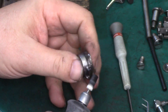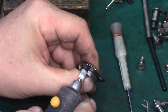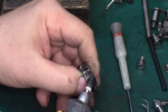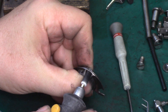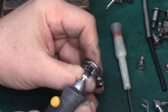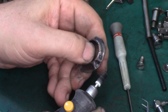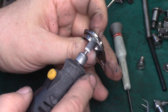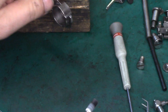There are a couple of areas you really need to concentrate on for polishing. One area is inside where the bobbin itself actually rides, and the other main area on the body is on the exterior where the spring attaches. The reason for getting this area right here is that this is part of the thread path — that's where the spring is going to go, so we want that super clean and super shiny underneath that spring. When it comes time, we're going to clean both sides of the spring as well, using non-marring pliers to hold that part.